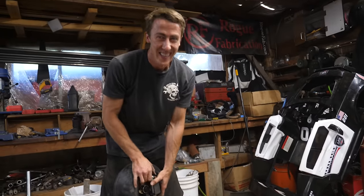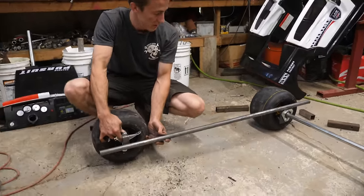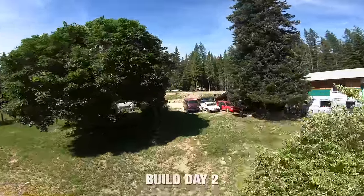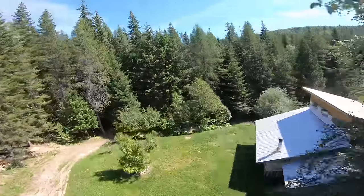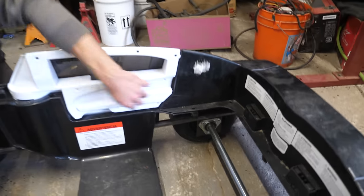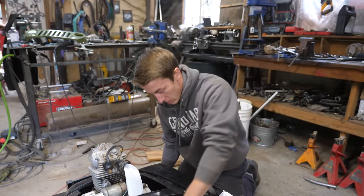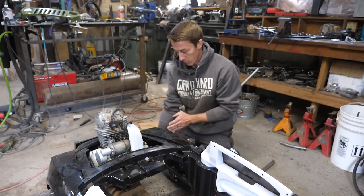So I got the first bar tacked on. I think I'm going to have to put the body back on to really see what I'm going to want to do here, but it actually will probably be able to be level — my eyes probably lied to me, I thought it'd have to be a little bit down. So we got this first bar tapped on to the back there and now I can come up here and see where I'm going to need to pivot. It's got to have some room for steering angle, so I'll probably cut this off here and start bringing the frame into the front engine mount, then re-support the spindles after that.